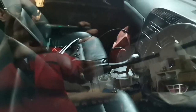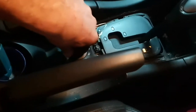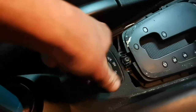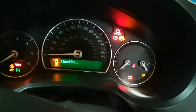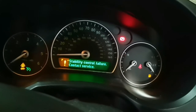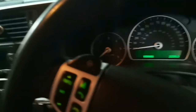So key placed in the ignition — ignition turns on, but when you turn the key fully it's completely dead. Press the pedal: nothing. This cover's been taken off by the recovery people who brought it in to take it out of gear. We've got a non-start situation. It goes to a system saying check-in and it says stability control failure, contact service. Let's get Tech 2 on and see what we can find.